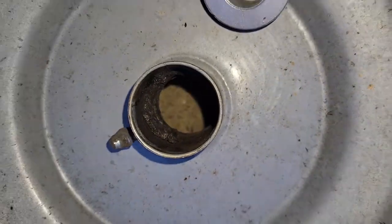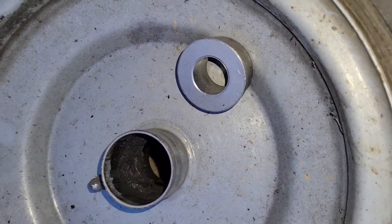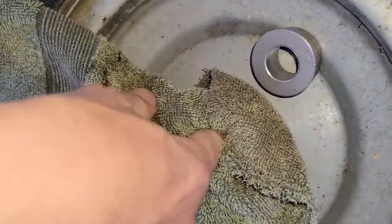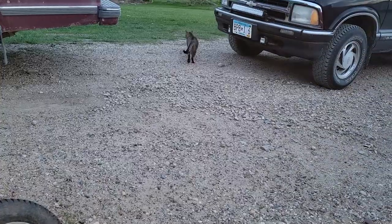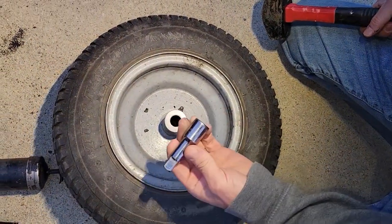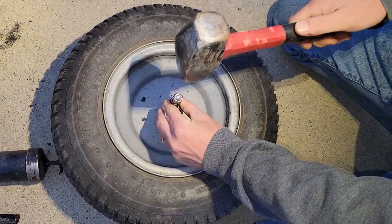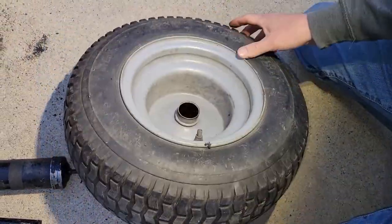What you want to do is clean out the material that's inside here — there's a lot of old worn-down bushings from last time. It looks like grease, but it's probably grease combined with the old bushings. We're going to get that out of there as best we can. Then I'm going to take this ratchet extension and put that right over the hole so it goes nice and level, and just pound her down — same on the other side.